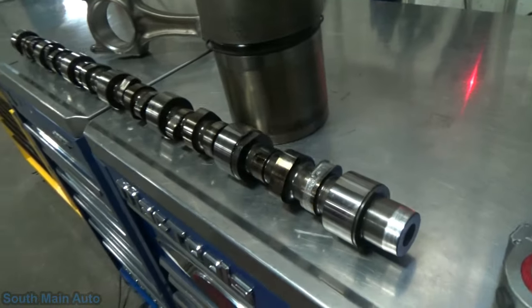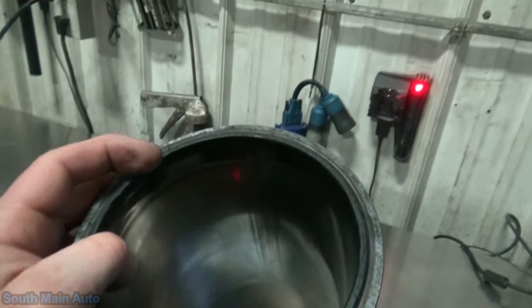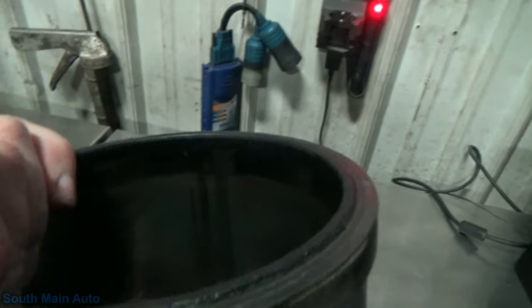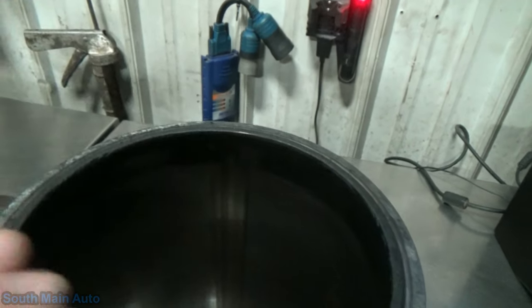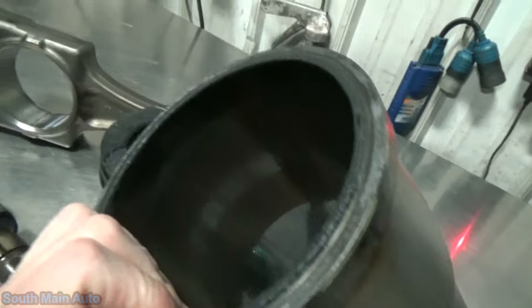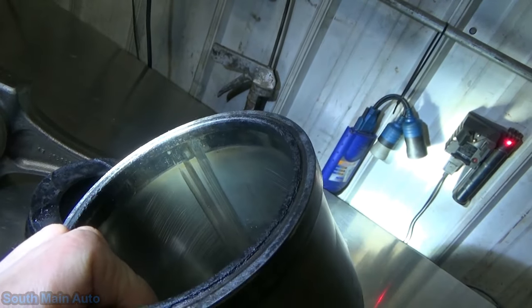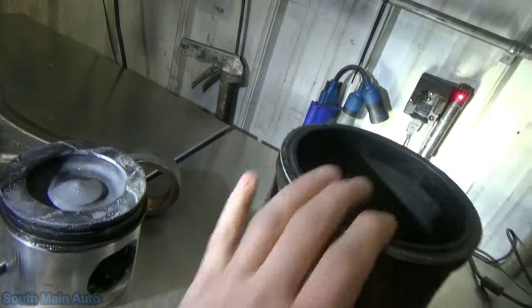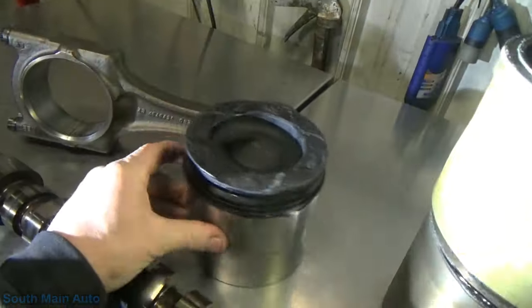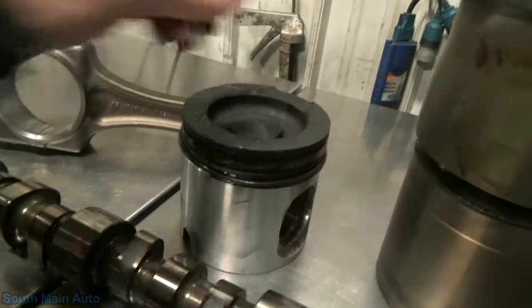Here's another bad lobe, but at 900,000 — almost a million miles — it's bound to happen. Our customer complaint was oil loss or burning oil. Here's the sleeve out of the number one cylinder. You can see that heavy scuff mark right there — you can actually feel it, it's actually a ridge in there. Shine a light in — you can see that scuff mark. The piston rings on this cylinder were broken.